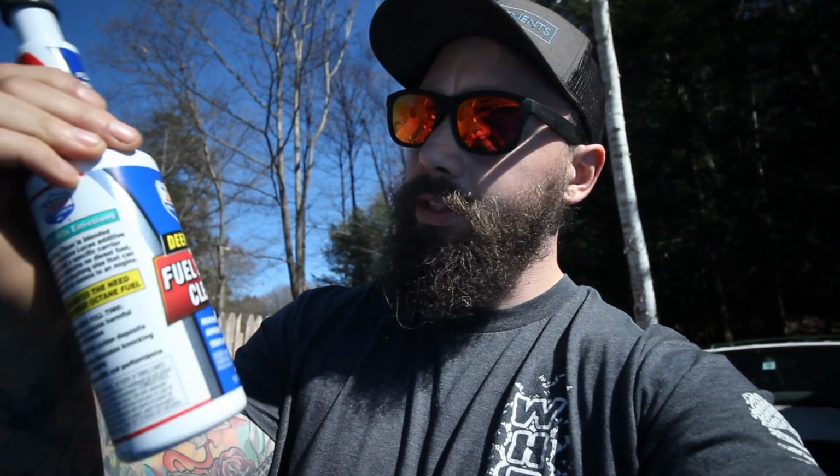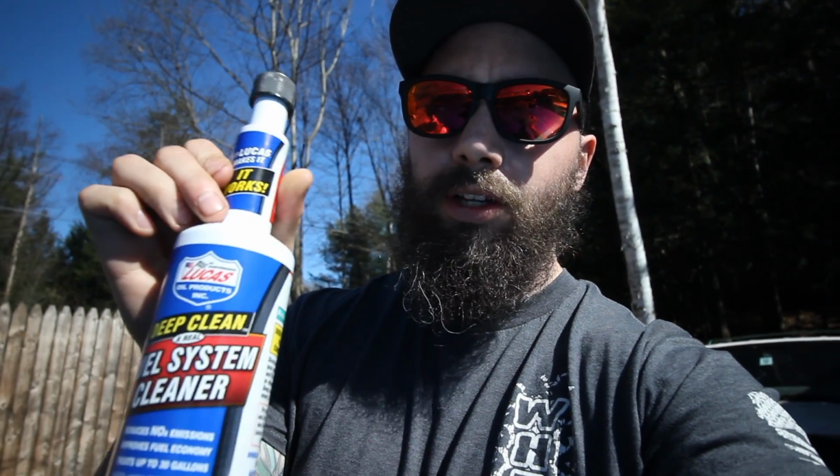Alright, so it's the next day here and it's like 60 degrees out. It's wonderful for working on the Jeep. I'm in a t-shirt. It's one of the few days that I've actually been able to be in a t-shirt and not even be a little bit chilly. The sun's really nice. I got some of this Lucas Deep Clean fuel system cleaner because yesterday when I got the Cherokee started, it seemed to spit and sputter a little, and I think the gas has just been in there a while. It doesn't really have fresh gas, so I'm hoping to put this in there and get some cleaning action going. Get the fuel system cleaned up and hopefully it'll run a little better till I can get some good gas in it.